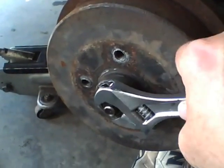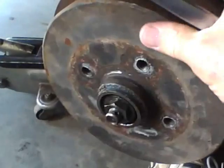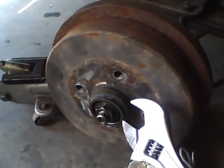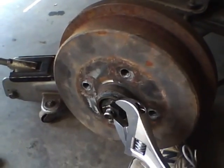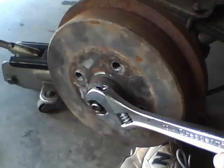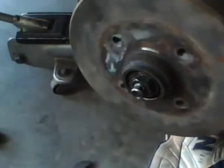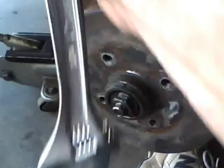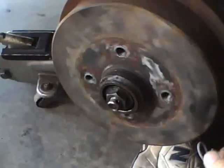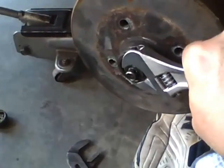What you do is rotate it while you tighten it up, and you put quite a bit of torque on it. To give you an idea, when we do this on airplanes - I'm an airplane mechanic and we change tires and wheels all the time - the nuts are bigger of course, but we put 400 foot-pounds of torque on to set it. We don't need to go anywhere near that high here, but you take it up as much as you want while you're turning it, then take the torque off to where it's finger tight, spin it around, and put enough torque on it to create drag. This is the way guys have been setting wheel bearings since day one.